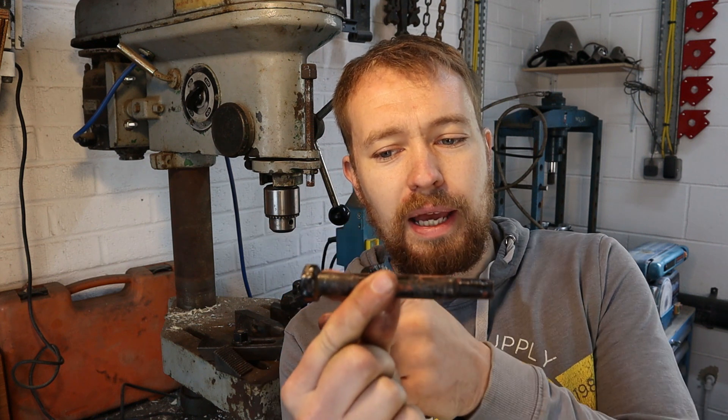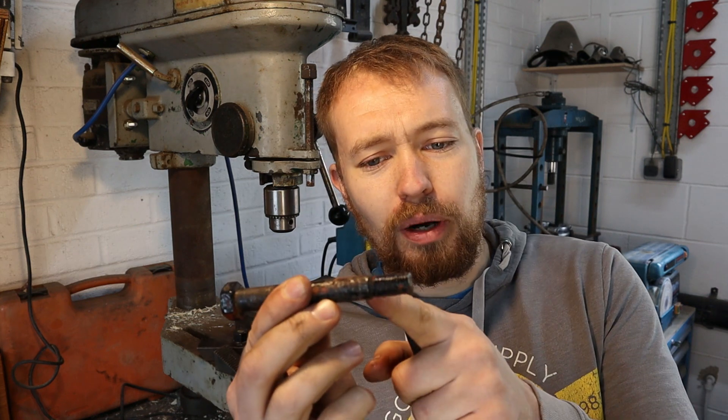The original shackle bolts that went into the shackles on my 1960 Series 2 Land Rover were British standard fine thread. I've got the only original bolt out of the whole chassis here. The rest have had their heads cut off and the threads cut off, which means I have no bolts to hold my suspension on. The original bolt has a step and then a 9/16th diameter to go through the bush on either the suspension end of the leaf spring or in the chassis.